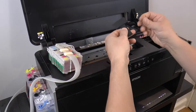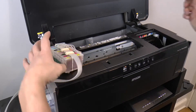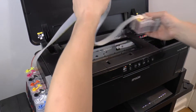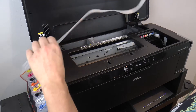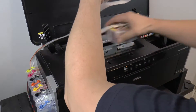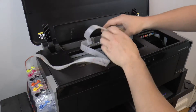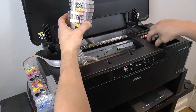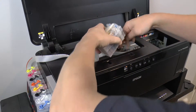The kit came with two retainer clips — one that goes here and another one you put where the tubes feed into the unit. The first thing we need to do is make sure that when we mount these, there's enough slack in the hose so the carriage can go completely left to right. You want to have these tubes routed as cleanly as possible with a minimal amount of twisting — flat all the way through. I'm going to feed this underneath the carriage by moving it over to the right, since you can actually move the carriage while in ink feeding mode.